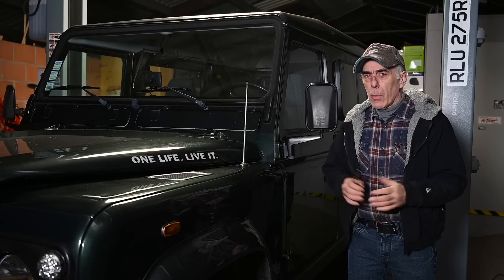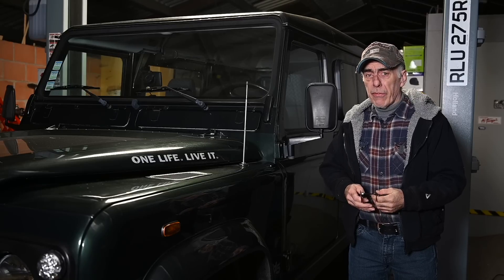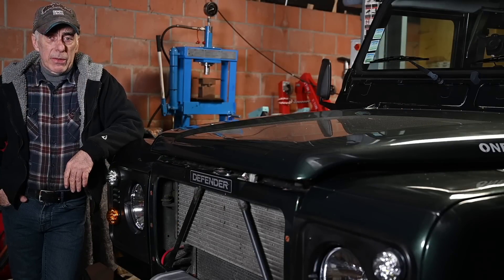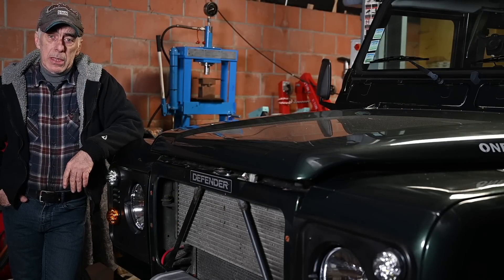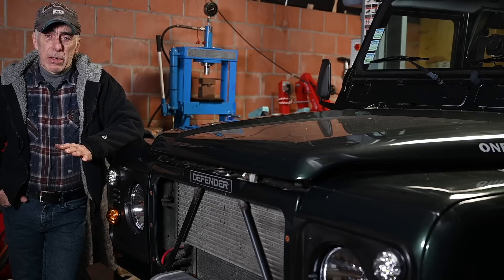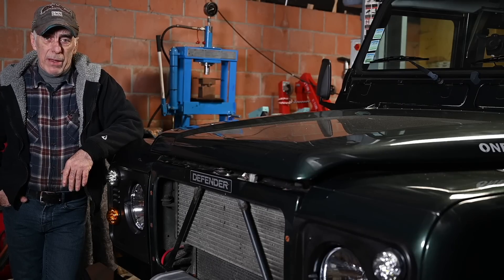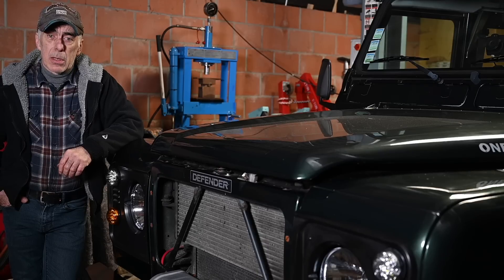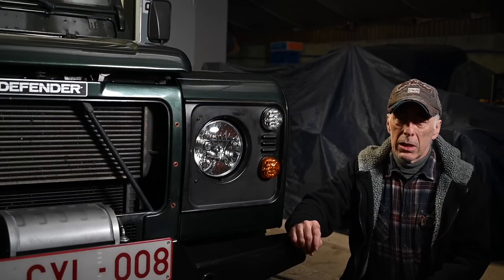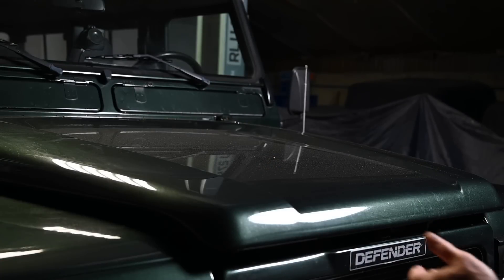Hello folks and welcome to the channel, or welcome back. In this episode we're going to be looking at a very common problem with the TD5 engine: oil creep into the ECU. Oil will eventually creep up over the wiring loom into your ECU, and if that happens you will have all kinds of issues. Eventually when it gets severe, oil will get inside the ECU and then your ECU will be toast. Not a pleasant situation, however you can prevent it. I'm going to show you how to identify if you have oil creep, what causes it, and how to fix it.